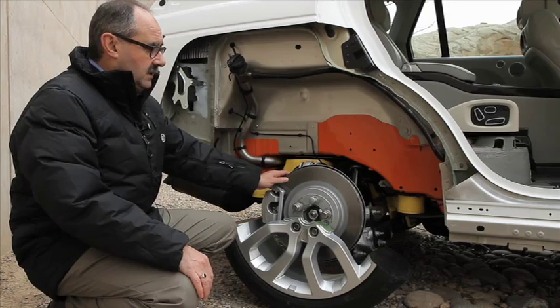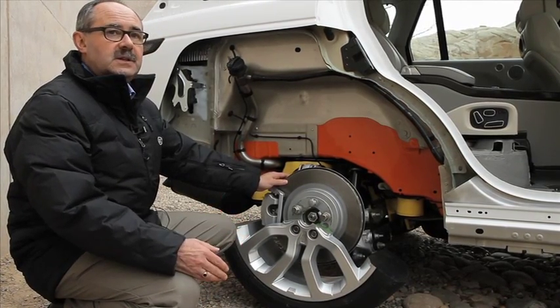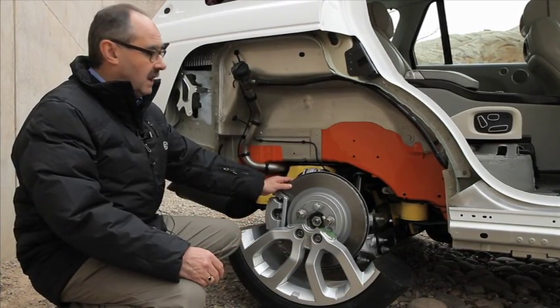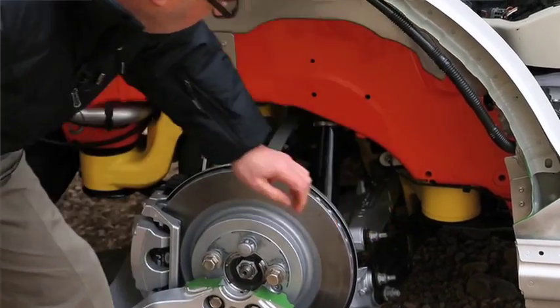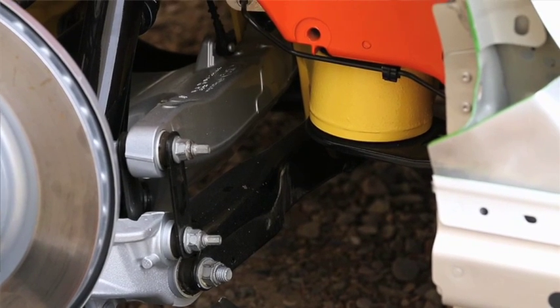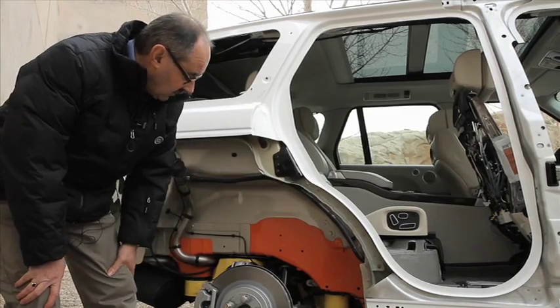The other thing we did when designing this new architecture was to put some safety features into the rear suspension so that there wouldn't be a catastrophic failure of the part in the event of a large impact off-road. This black component here is made out of high strength steel, and you can see it's got a neck feature in there. That element of the suspension will collapse if the vehicle is overloaded and protect all the rest of the vehicle from damage. So that's the most cost effective component to replace, and it protects all the rest of the rear of the vehicle.